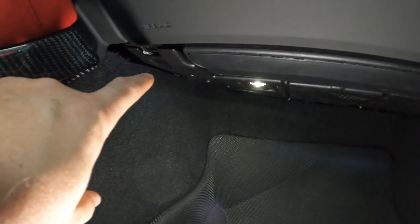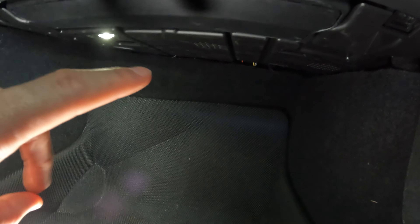To get this lower tray off, you're going to have two front bolts and two rear bolts. The front bolts are in these little notches - I believe they're 7mm. There are two here and two hidden in the back where it kind of indents up into the car. You'll have to feel around with a mirror to find those - the angle is so crazy and awkward back there. Maybe I can show a picture. You need to remove all four bolts - some people only found three but there are four 7mm screws. I'll remove those off camera and then we'll take a look.